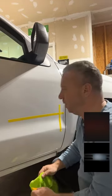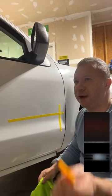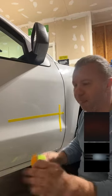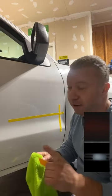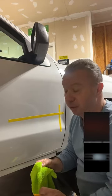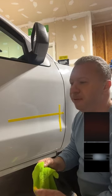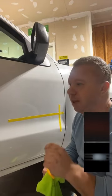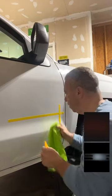Let's talk about rinseless washing then, because guess what? That car that I rubbed down with gasoline, which is the most aggressive possible way you could have done anything to that car, was also, by the way, original paint. And the car is 100% original, including the nearly 70-year-old leather on the inside. Guess what that got cleaned with? It took 5 hours to clean two seats. What did you clean it with? Absolute rinseless wash in a spray bottle and the softest of soft brushes, and just hours. Got it off. And not one lick of color came off on a single towel.